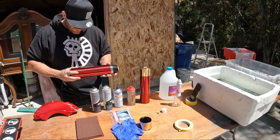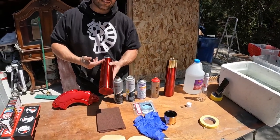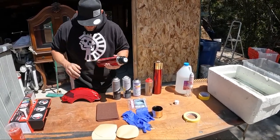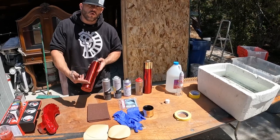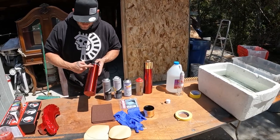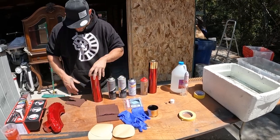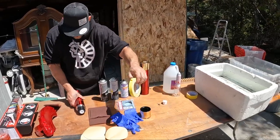These parts are hydro flasks. If a part has shine on it, we want to get rid of that shine so the paint will stick. Step number one with every single part is always cleaning it off from any grease or oil, because paint does not stick to that. So we clean it, then sand it down. With a part like this that's already smooth and has paint on it, we use a scuff pad — it does minimum scuffing and gives you a better finish at the end.